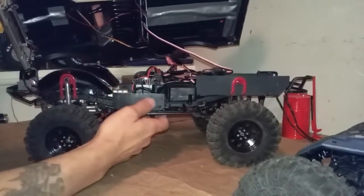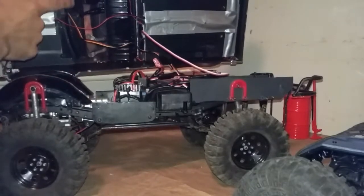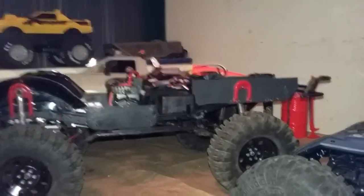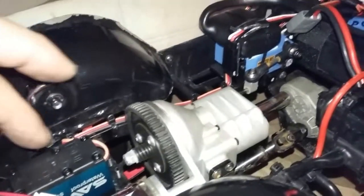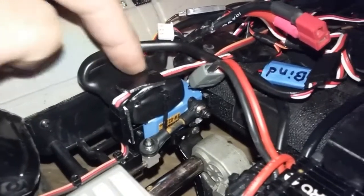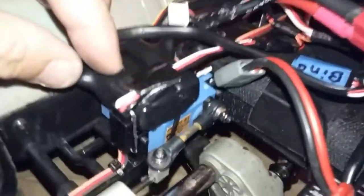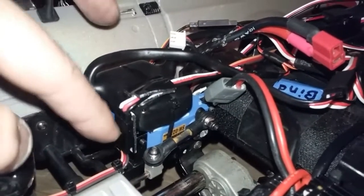Alright, we've got some wires hanging off right here. This is the main whip that goes down to my lights, coming off the winch controller. This one goes to a small servo sitting in my dashboard that is actually hooked up to the steering wheel. I'll set this off to the side so it's not hitting anything. Moving around so we can see what's going on — new steering servo that was installed in our previous video. Here is the wired winch controller that has been Plasti-Dipped and is double-sided taped to the shift servo. It also has a zip tie going around it making sure the shift servo is not interrupting anything. This piece of double-sided tape keeps that wire held in place.